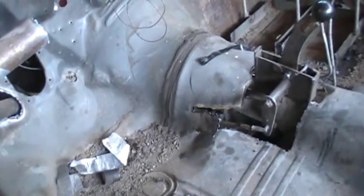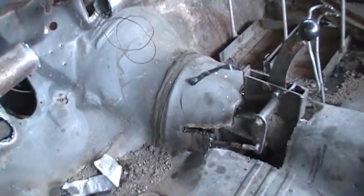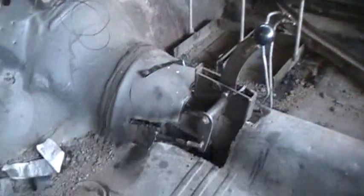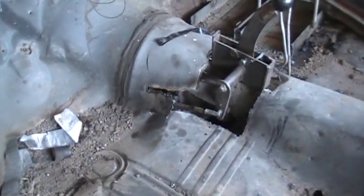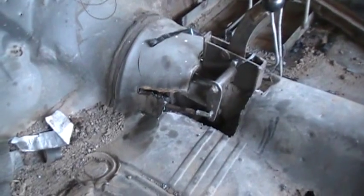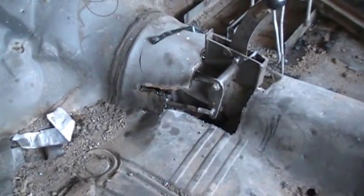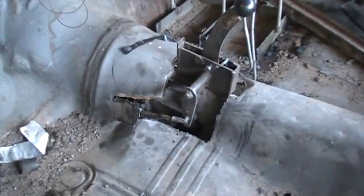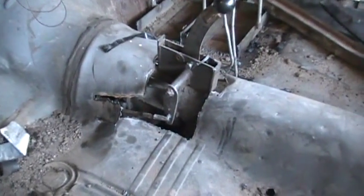Other than that, just look everywhere. This floor is damaged, and this car has been bellied out a couple of times. One of the first things you do before you start scrapping it is check for damage so you know what you're working with. Also check for what bolts have come loose — it's amazing how loose the bolts get on these things sometimes.